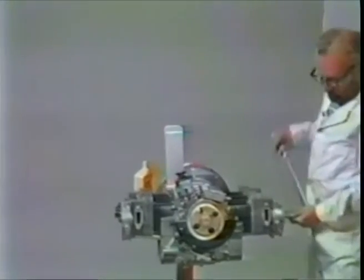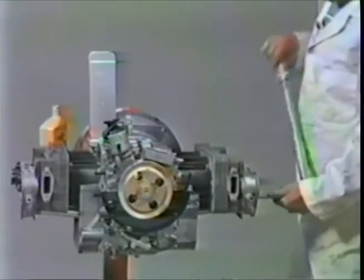That's about 10% higher than stock torque. And that seems to work pretty well. The head nuts don't strip. The studs don't strip. The head does not dig in too much to the cylinders like it will if you go much higher than that. And everything seems to work. It's about 10% higher than the factory recommended torque on the head of 22 foot-pounds. I like to use 25 foot-pounds. And that seems to be the happy medium that I've discovered over the years.